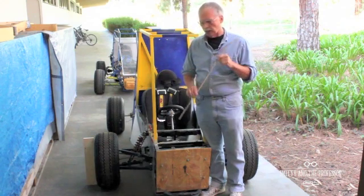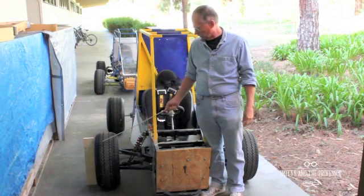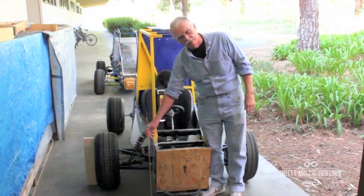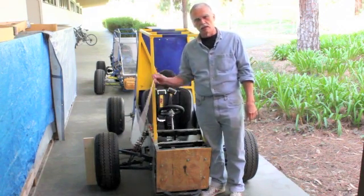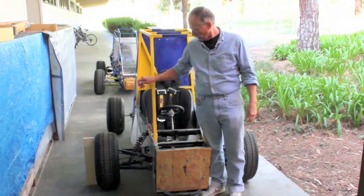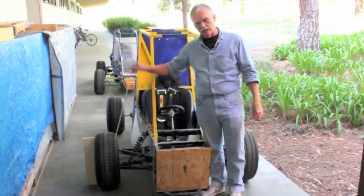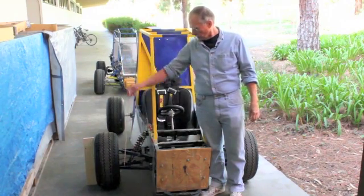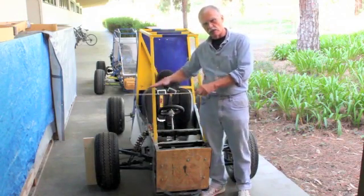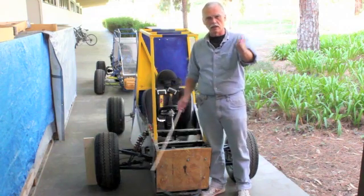The first priority, the first job of suspension is to move up and down and keep the tires in contact with the ground. The tires should never leave the ground — a tire in the air has zero friction. The job of the suspension, the springs, the linkages, and everything, is to allow the tires to move up and down. Whatever the body's doing — rolling this way or that way, pitching slightly up or slightly down — the tires never leave the ground. That's job one.